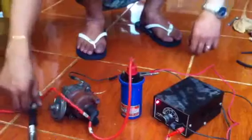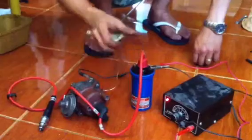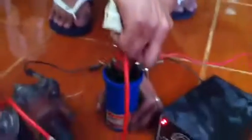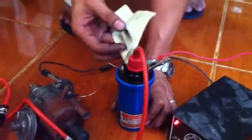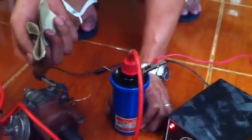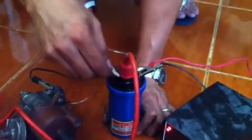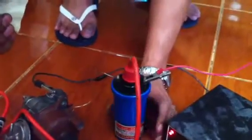The problem for this one is this coil that I have is having a leak right here. I noticed when I opened this cap there's a small crack in there. Sometimes it arcs the bolt in this negative connection, so it could probably cause a problem in the future. Either I'm going to cover the crack or just replace the whole ignition coil.